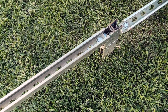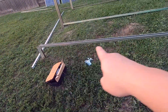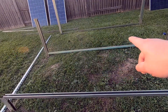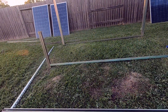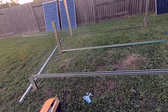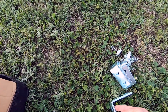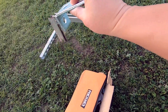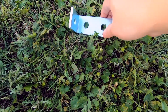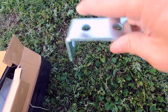In this video I'm going to show you how we are going to attach these horizontal support bars using the 10-foot unistrut or super strut. This is an uncut 10-foot piece, and we are going to use these L brackets. This side of the bracket is going to go to the vertical column, and these two holes here — we're actually going to attach just one screw on one of the holes, which is the first one — is going to attach to the horizontal unistrut.